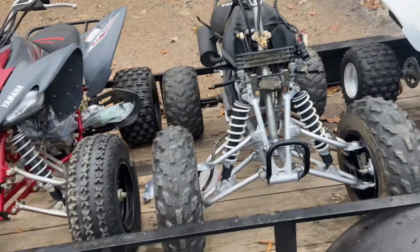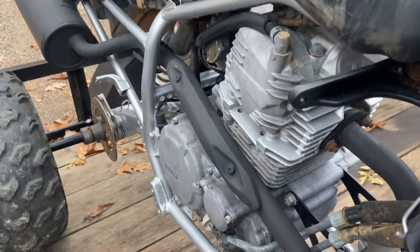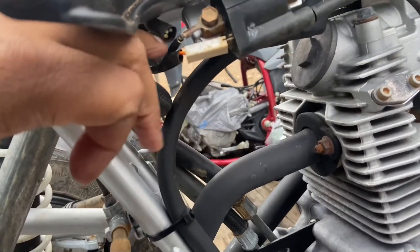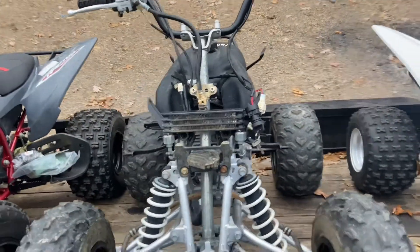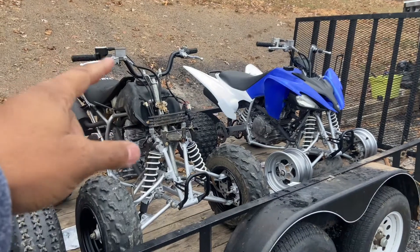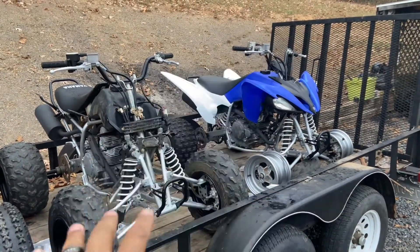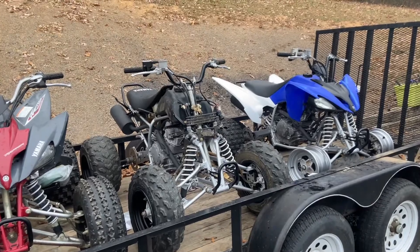We have to get the lights off of my daughter's quad because we're going to do the same light bar setup, so the lights are going to go here. One of the things I did see was that the prior owners cut the headlight wiring off — you can see one of them cut right there, yellow, black, and green — so we're going to get those reconnected. This one is going to get some new front tires. Both of them are going to get new 18mm windows into the master cylinders, then I'll bleed the front brakes, put the rear brake calipers on, and run the chains. Hopefully in the next video everything will be complete.